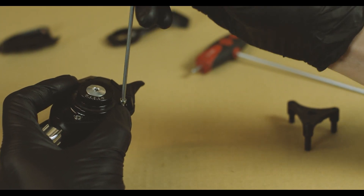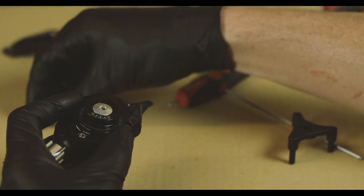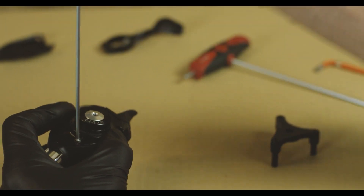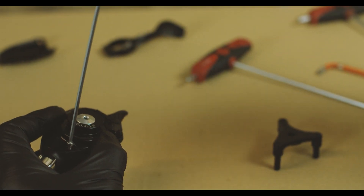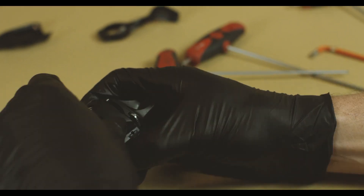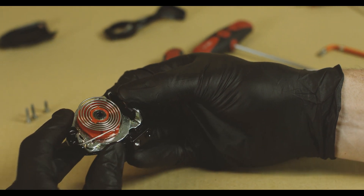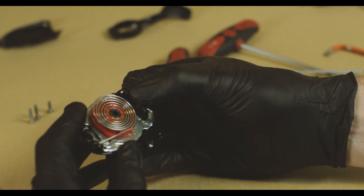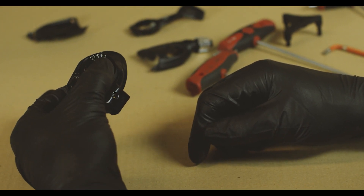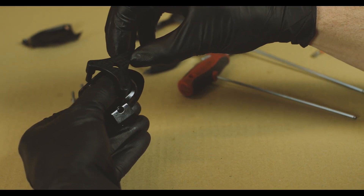When you're removing these bolts, make sure that you are pinching the shifter body with your hand to keep everything from coming apart. Set these bolts aside somewhere you can reach them because we're about to reinstall them. Now flip the shifter body over and remove this plastic cover. Set that aside. Now we've exposed the internals of the shifter. I'm holding this shifter together because the bolts are removed, and now we're going to place the claw over the bolt holes and reinstall the bolts into the claw.